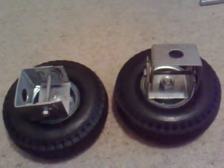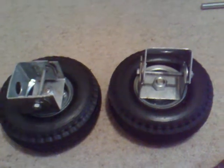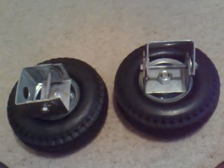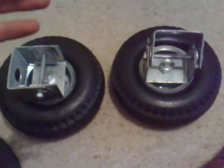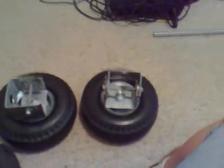On Wednesday I'm going to weld up my frame and then weld this on. I'm going to make it a live axle — hopefully get a friend to make up my axle, which will be like one inch and then go to three quarter inch. I'm going to get a sprocket holder and instead of making a keyway in the axle, I'm just going to weld the sprocket holder on, because it's pretty hard for me to get sprockets here — I'd have to order them online and I'm not sure if they'd fit properly. So using a live axle is going to be a bit better.